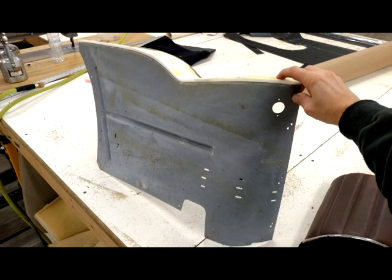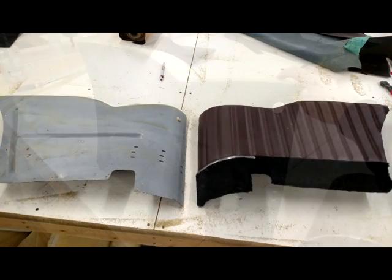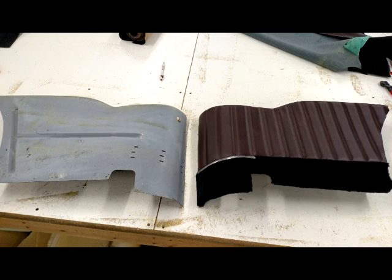This is the bare quarter panel armrest that is installed from the factory. This is primer steel right now. We also install a half inch closed cell foam on the top for an armrest pad prior to recovering it. As you can see, the left side is the factory steel one that has not been recovered. The right side is our new custom cover.